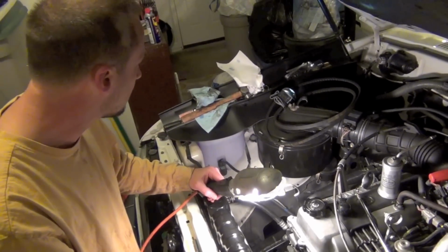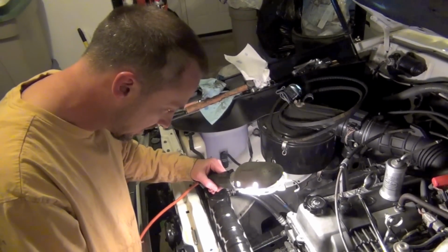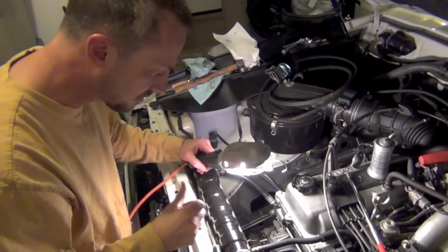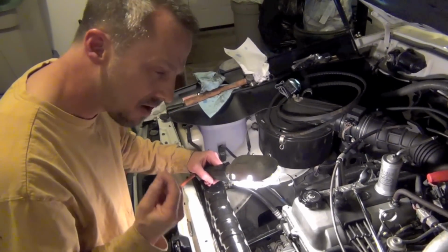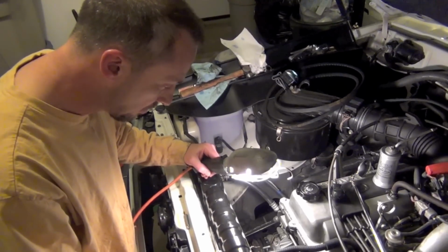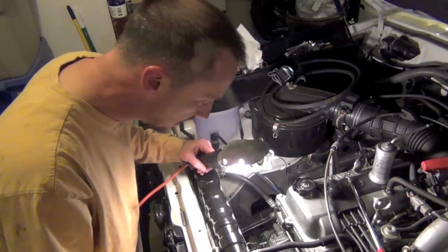We did end up using a little bit of Vaseline. I think we used Aquaphor actually on that O-ring to kind of just hold it in that groove. We just dabbed about 5 spots around on it, and then put the cover on. We used a small dab of blue Loctite on each screw just to help hold them in place so they wouldn't back out. But after all the trouble we had, we didn't want to put too much Loctite on them.